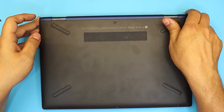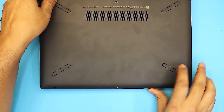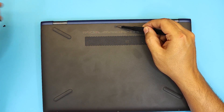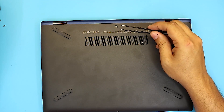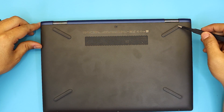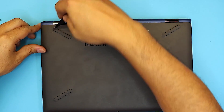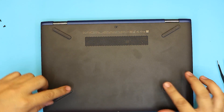In order to open your laptop, you want to remove the three screws at the bottom side right here. I already removed these screws. Remove the three on the front, and there's a hidden screw right in the middle — you have to remove a plastic cover, then loosen and remove the screw. There's also a hidden screw right under the rubber legs — one on each of the top two legs. Remove those.